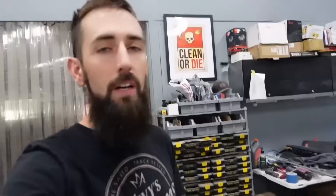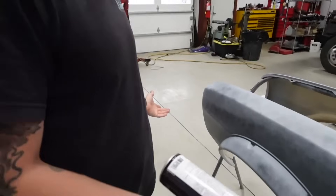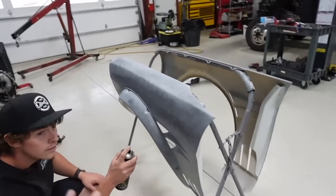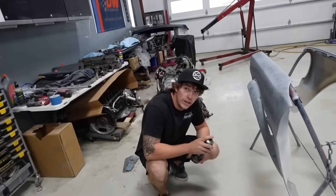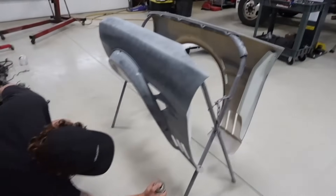We're going to show you guys how to use guide coat. Do you know how to use it? You just sand out the black - the dark is the low spots. Dark is low, because it builds up under it. The difference from regular spray paint is that guide coat is kind of dry and doesn't clog up your paper. Regular spray paint will trash your paper - you'll get like three swipes and you'll just be pissed. Guide coat is more dusty-like.